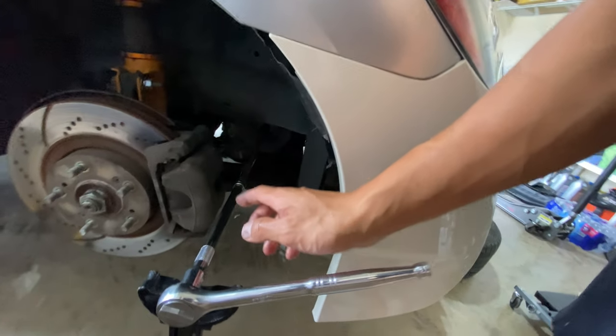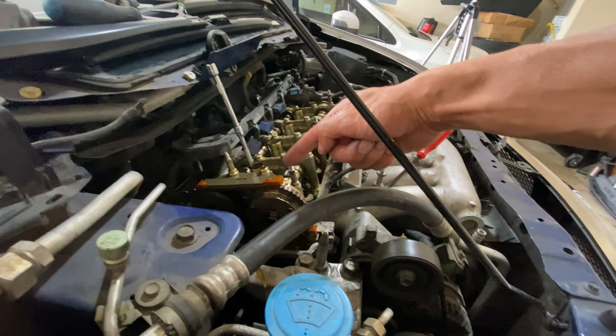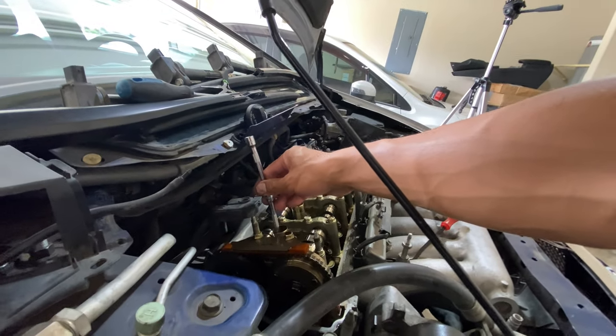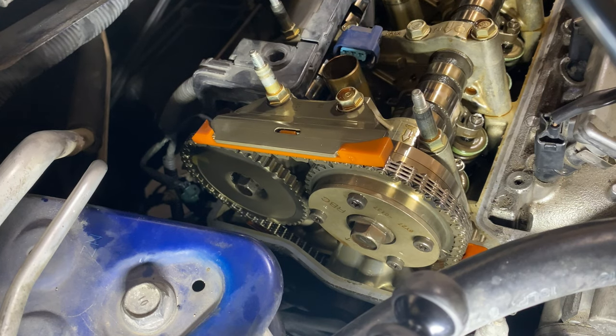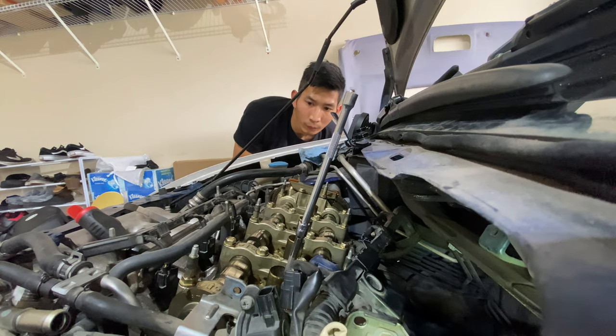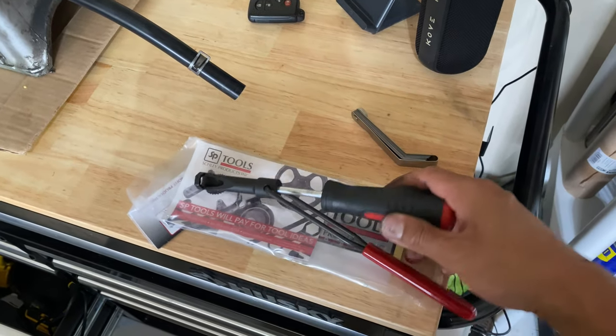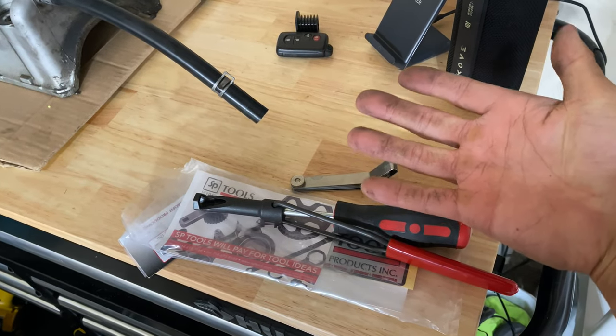Now for the fun part. I got a 19 millimeter socket on the crank pulley bolt, with a little jack stand to support the long extension. Got it on top dead center — it does have an arrow and I use this long extension to make sure it's at top dead center. In case you're wondering why I took out the spark plugs, it's because when you turn the motor it creates pressure making it really hard to turn. So you take the spark plugs out and it's easy to turn the motor, and you can use a long extension to help you find top dead center. A couple of special tools I got for this project: a valve adjustment tool and an angled feeler gauge. I definitely recommend having the right tools — it just makes the job easier. I'll leave links to these tools down in the description below.